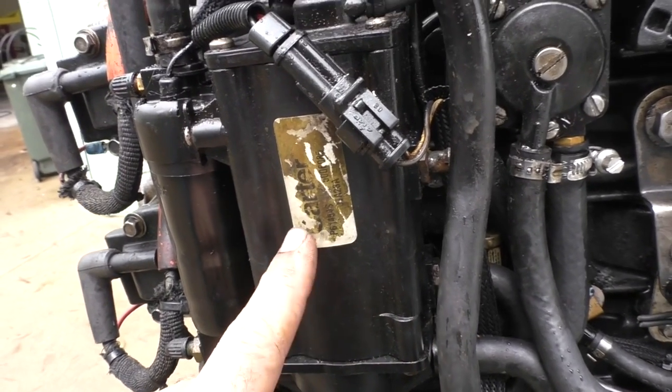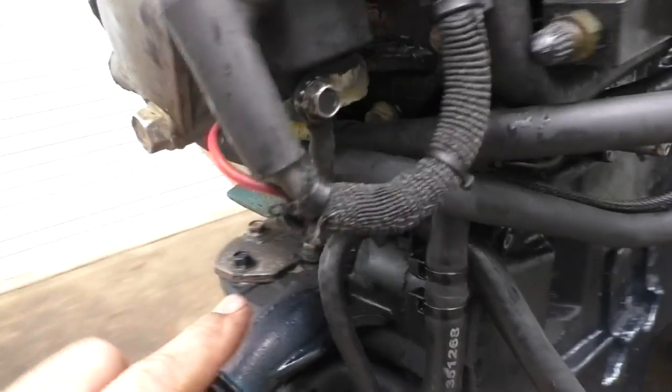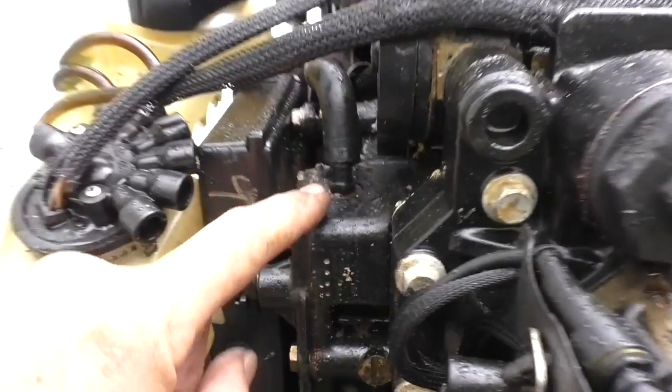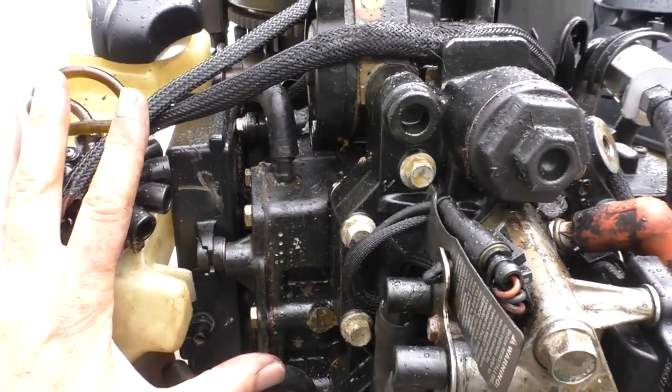There's a coil, so the water goes through the coil to cool the fuel, then it comes back out, and from there it comes around here to the outlet. So that's the full route — it goes from the exhaust cover to the outlet — and if you've got a blockage anywhere in that system, you won't get a telltale.